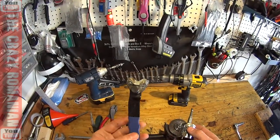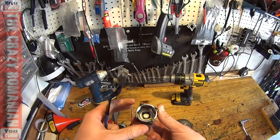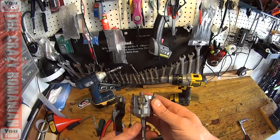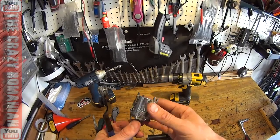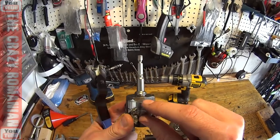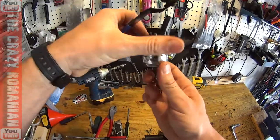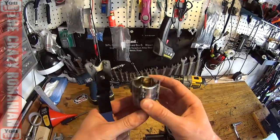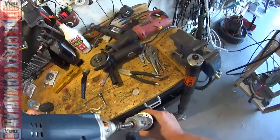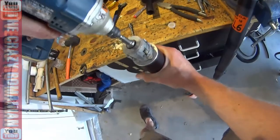If you watch the video all the way through, this particular tool was replaced by this — and this actually worked really, really well. It's just a socket wrench with four bolts that I've welded to the side. This socket wrench lived two lives: first it was ground on the side to fit a Yamaha motorcycle fork cap, then it became a four-pin cap remover for a KTM. The four pins match perfectly and you just put it on the cap and use an impact drill to remove it.